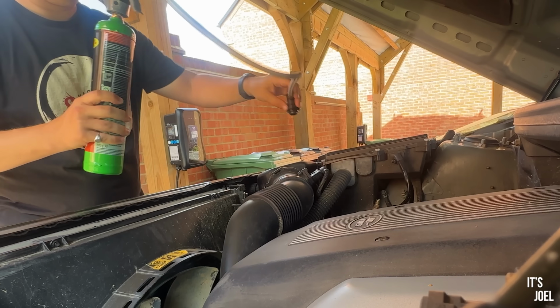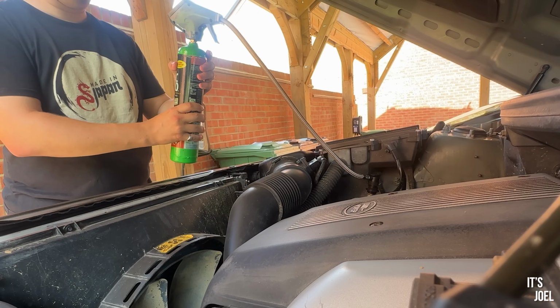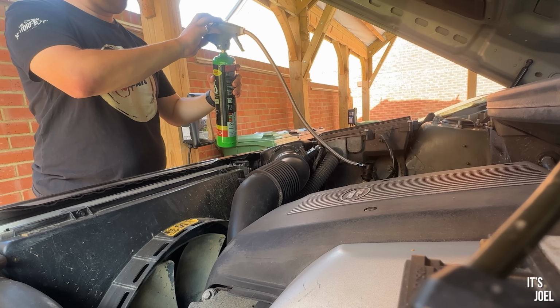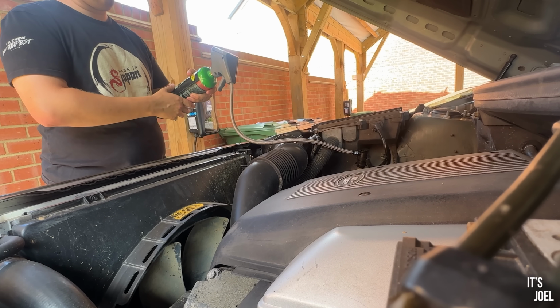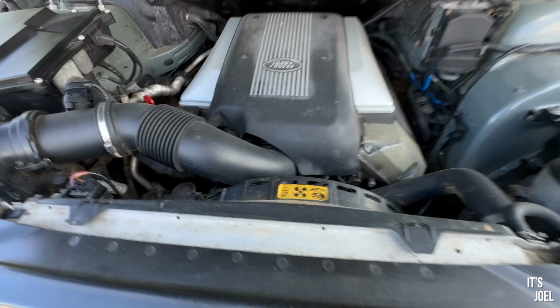Right, so as expected, the L322 read 0 on the pressure gauge, which means we can't regas it because it's a little bit dangerous, because the gas is probably just going to go everywhere if I try, and it's really harmful stuff actually, this refrigerant. Also, it's redundant because it will just leak anyway and could actually over-pressurize it quite easily and damage whatever's left of the system. But obviously that needs some further investigation, something I'll probably take it to Glenrans for.